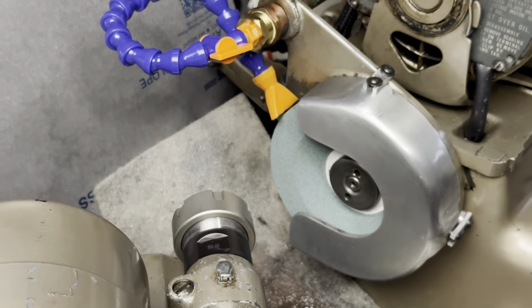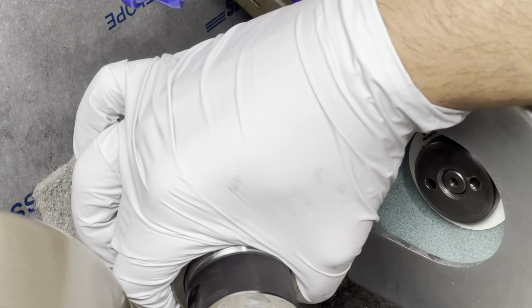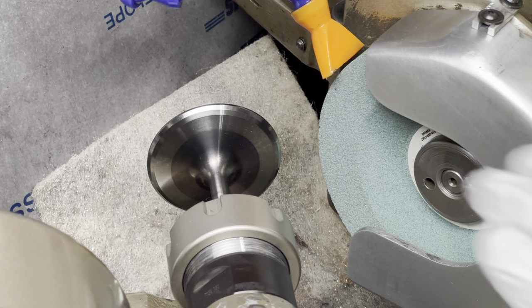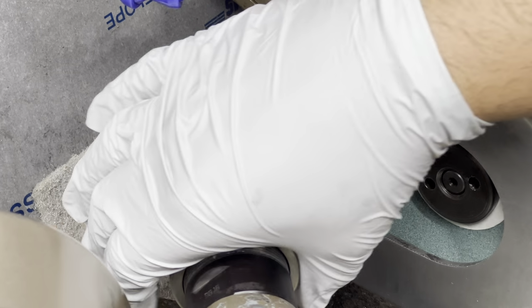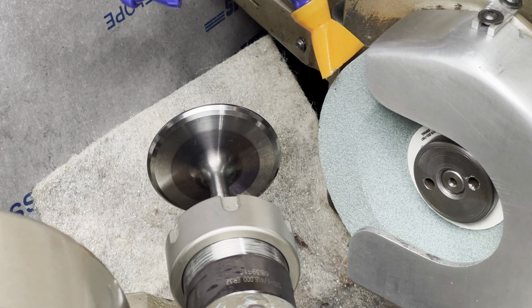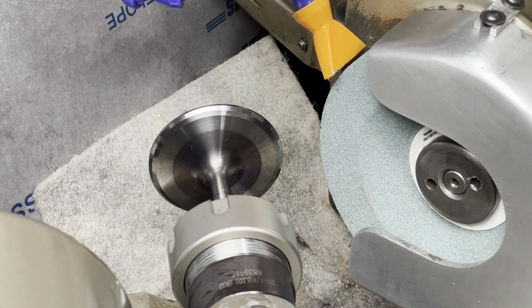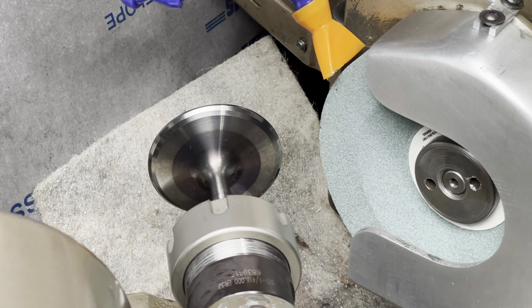Look at that. A lot of guys are scared of the collet chuck. They say it takes too long. They think that you've got to fumble around with these wrenches and, you know, it's just too much screwing around. They need to grind their valves in 15 minutes. Well, that's why this stuff exists. And really, it's not that much work. Instead of pressing a button to take the valve out of the chuck, you just grab the nut, loosen it, and put a new one in. It's not that bad. And I don't really express much desire to blast through a bunch of valves and pushing some stuff out the door. I want to take my time. Treat it with, you know, love.